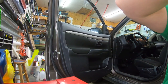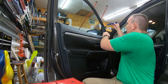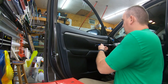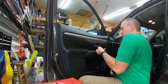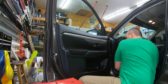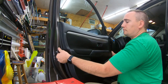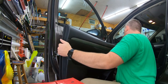The only other thing you want to do is get a nylon pry tool and pop the top out, because it makes it easier — you need to lift it up off. Then grab your screwdriver, or in this case my impact with an attachment, take out those two screws, set those aside. Grab the cup holder, grab the bottom corner of the door panel, give a tug — pop right up, get it loose, slide it straight up and off.